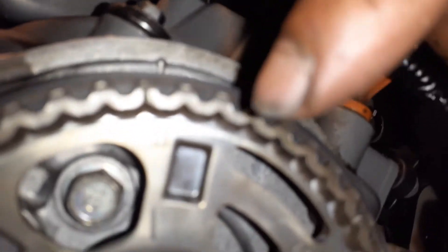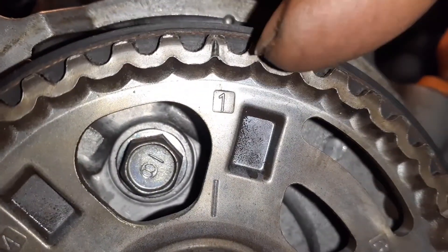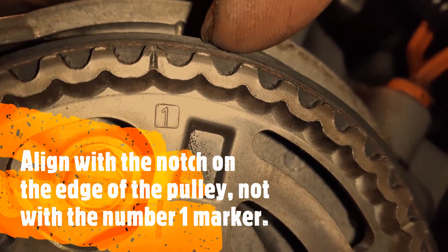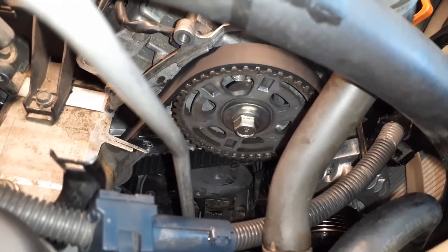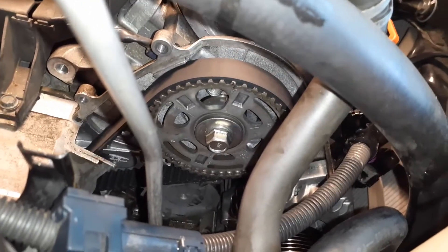While testing I found that it's off by one point — one groove. This is the mark you can see, and this needs to align with the back. It's in the middle right now, but it needs to be over here to be aligned. On this side it is pretty much aligned, so this one is aligned. The front one was the problem, and that's where I got the P0344 — camshaft sensor number A.